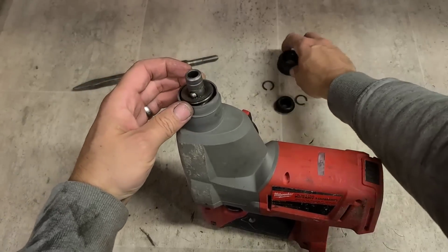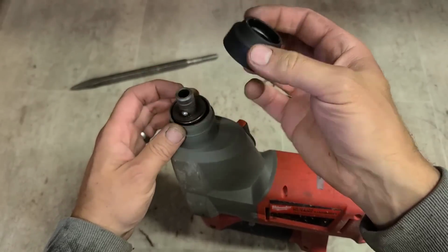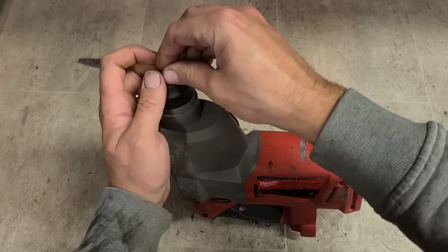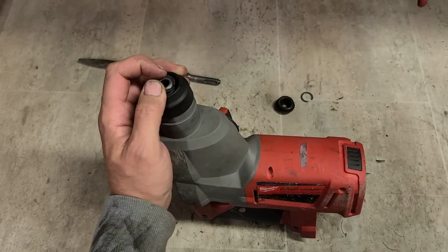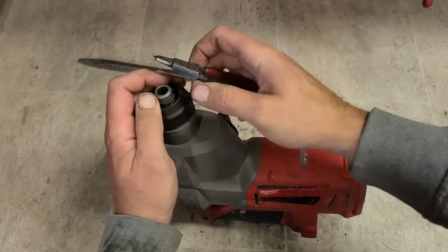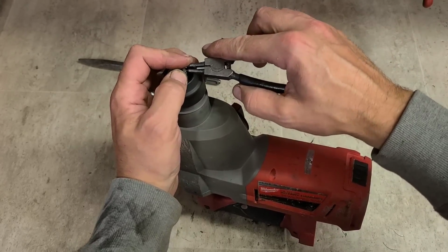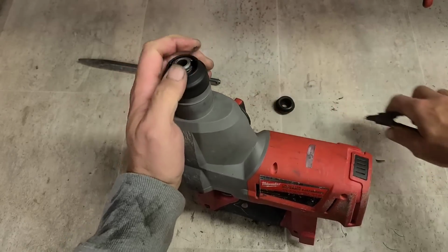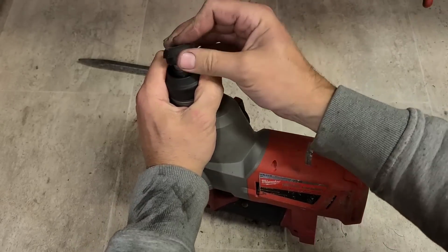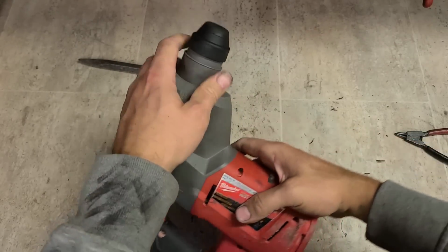That keeps them pressed up. Then it's this here plastic sleeve that locks everything in position. It's not just plastic, there is actually a metal insert inside of here. So it actually locks it in position. Two spring clips then. One to hold the plastic sleeve on, and one simply to hold the rubber cap on the end. And then this one goes on second. Rubber cap over the top. And that should be it.